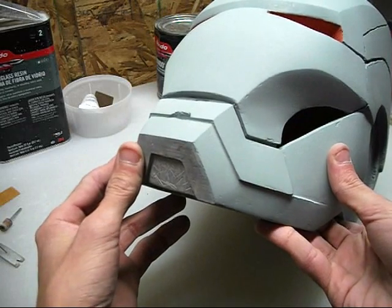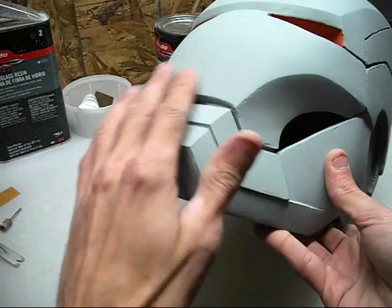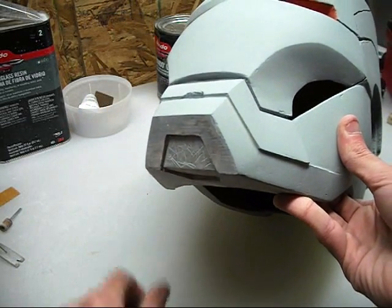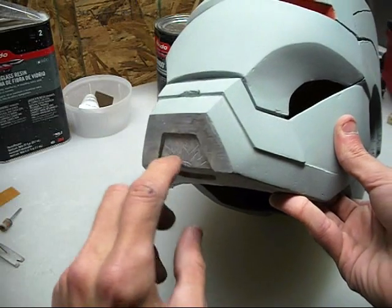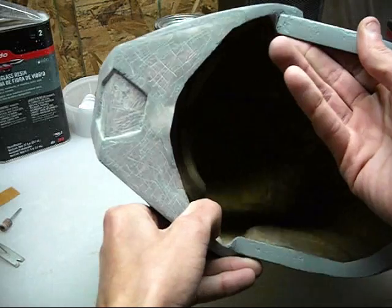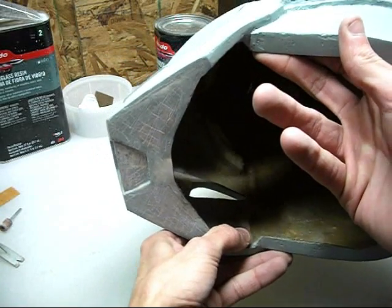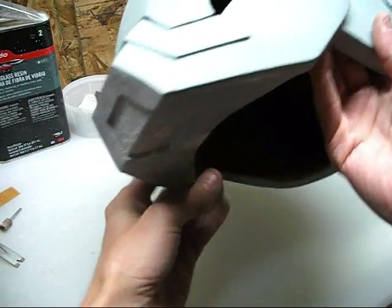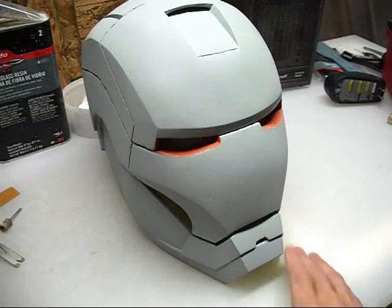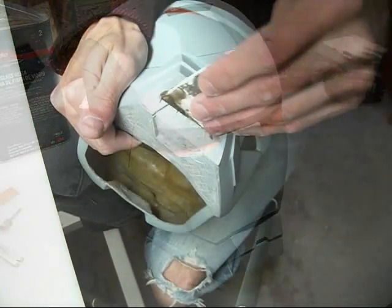I've actually sanded the primer completely off. Now, you don't have to do that. You don't have to get crazy with it. At least scuff it up, though. I also added just some gouges in here with a file just to give it more tooth to grab onto to adhere. I've done that on the bottom as well. You can see all the gouges. So that'll make sure that my Bondo sticks on there nice and good. So I'll get that smoothed out on the bottom, Bondoed up, and that should do it.